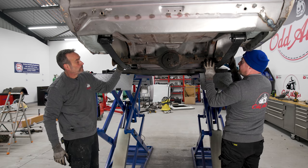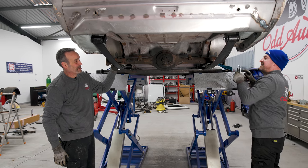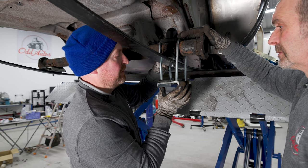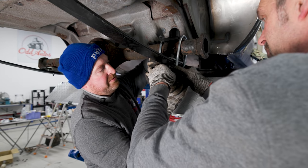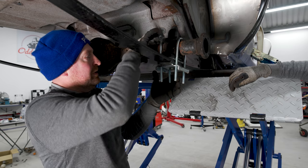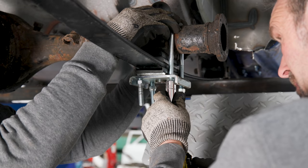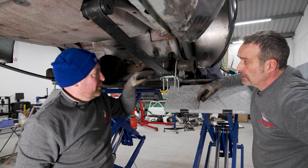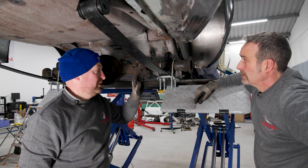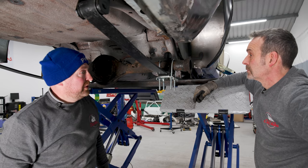Hopefully we've got that the right way round now. Can't do that when it's painted — but we will. That's it. Right, do you know what, that wouldn't surprise me at the moment. Let's get these U-bolts in. We'll get it right in the end. We might need lowering yet, so we might have to put a bigger aluminium block — a bigger spacer in there. So we'll leave these like that for now, and then if we do we'll cut them off once we know the ride height. Right, let's go and lob the diff in and the half shafts.